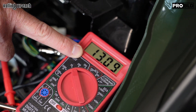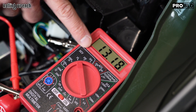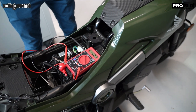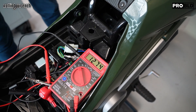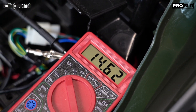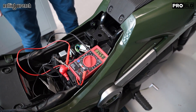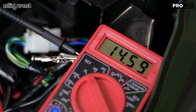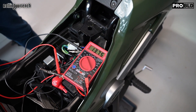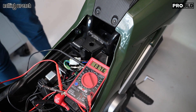We want this to be between 12.5 and 13 volts or more at idle — 13.5 is fine. It cannot go above 15 volts. As you can see, it's charging just fine at idle. Next, we want to rev up the engine to about 3,000 RPM and hold it there. Notice the volts are going up to 14.6. The most important thing is that volts are rising and not exceeding 15 volts. If it goes above 15 volts, you have a bad rectifier regulator. If the volts aren't climbing, it could be a bad stator or a bad rectifier regulator — but most likely it's going to be a bad stator. This is how you test the charging system on any 12-volt system.